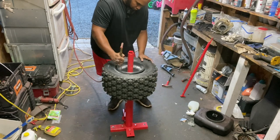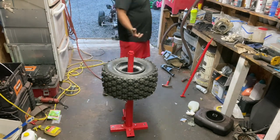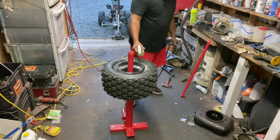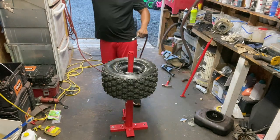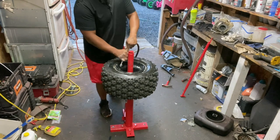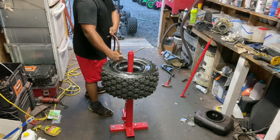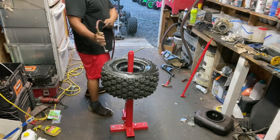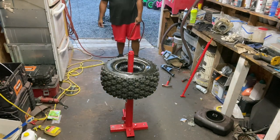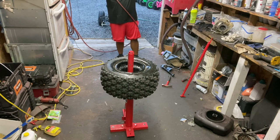We're going to fill it up with air. One of the things you need to make sure you do is put some lubrication — some kind of liquid around the outside — so it helps seat the rim better. Understand that you are going to be pushing air from between the rim and the tube out, so it's going to look like it's leaking. To the normal eye, if this didn't have a tube in it, the bubbles you're going to see are a sign that you have dirt around your rim or it's not seating correctly. However, that is not the case when you're using a tube.